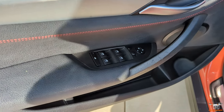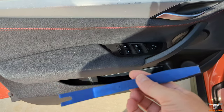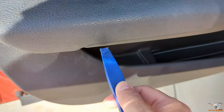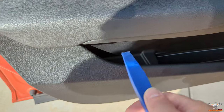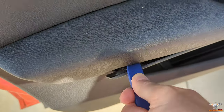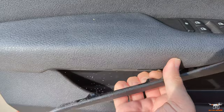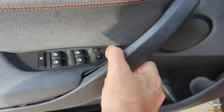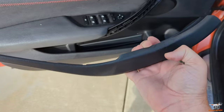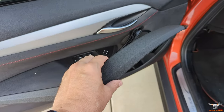The replacement piece has a little less of that rubber texture feel. Get your trim removal tool in here — I'll link to a kit on Amazon for about five bucks, they really come in handy. Just get in here and pry, work it along, and pop it out. Now we're going to pull the whole thing off — it comes off super easy. There's a bit of a gooeyness to it from the heat and wear; I can feel the tackiness on my fingers.